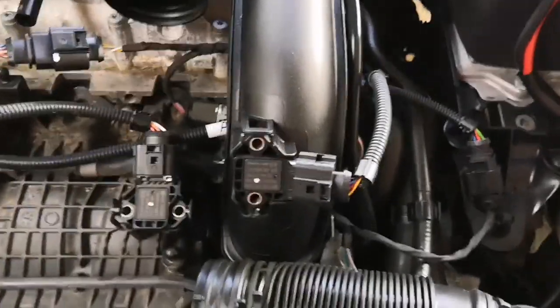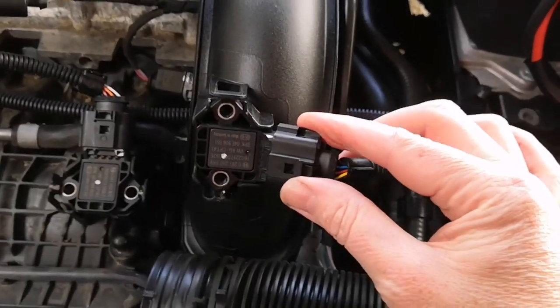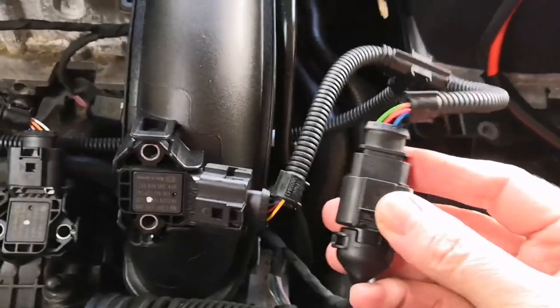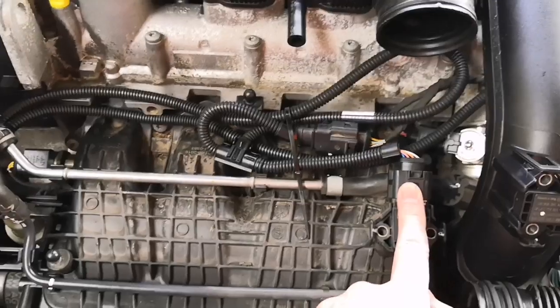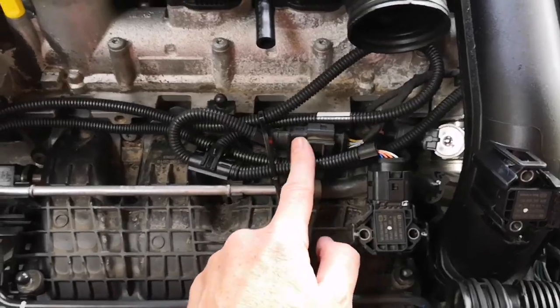Take a good look at your manual. End A, which is here, connects into the turbo pressure sensor, and the sensor that originally came out will go into the other part of A. I've also put end B into the manifold pressure sensor, and obviously the wire that came from the sensor goes into the other part.